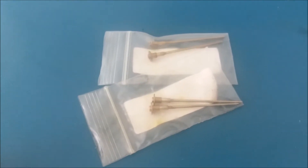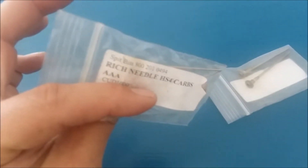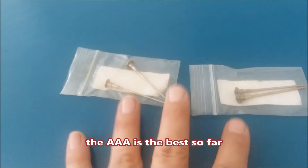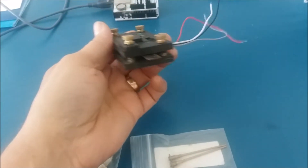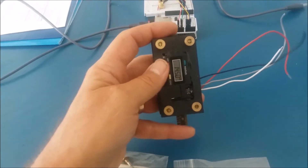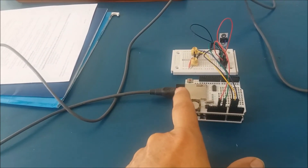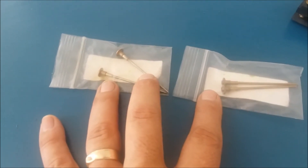The purpose for doing all of this is these guys - these are the needles that go in the carburetor. I've got a set of AAA rich needles from SpitBits, some stock ABT needles, and an AAQ. Each of them, as we'll see in another video, has advantages and disadvantages for their profile. But I don't have the right needle for that carburetor. I'm making a needle height sensor - it'll attach to an arm that goes up and down, measure the needle height, and send it out to my Arduino data logger. Not only will I log the needle height, but I'll also log the air-fuel ratio, read it on an SD card, and analyze that to see which needle I need.